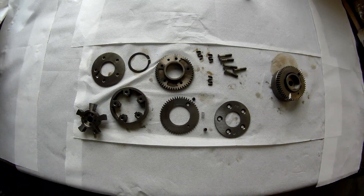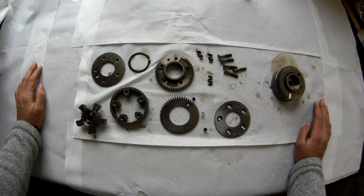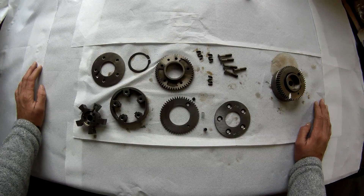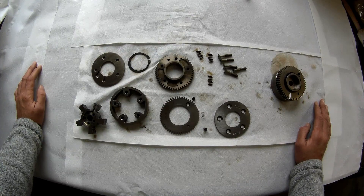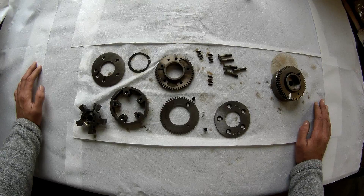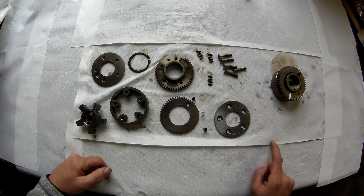This is a common problem — they wear out and then you should buy a complete new adjuster. I did some research about this, and a company close to me that I sometimes drive cars for reviews had a C63 with a rattling sound on one of the cylinder banks. On the left bank, this was the most common thing to change and it was a worn-out cam adjuster. They changed both cam adjusters on that side, intake and exhaust. I want to show you how they look on the inside, and there are some things you will read and hear about on YouTube that are wrong. I just want to show you how it looks inside and what really happens.